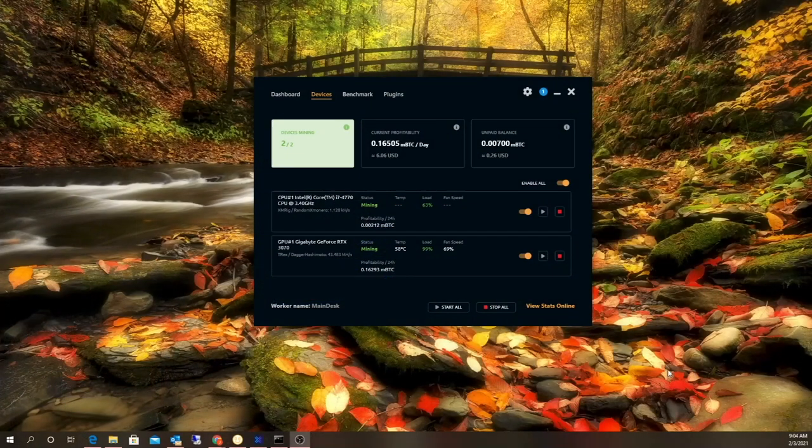Here's NiceHash running on it. Right now I'm not getting the full megahash I could because I'm recording this video, but last night it was sitting at about 50 megahash pretty consistently. I could probably bring it up to about 60 megahash like I did on my other card, but I'd have to raise the memory clock, which generates more heat. Running at full power I'm probably doing about 190 watts. It's definitely the nicest - and most expensive - video card I've ever owned.